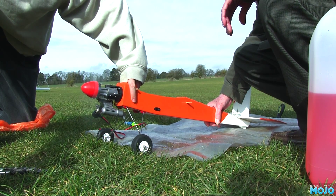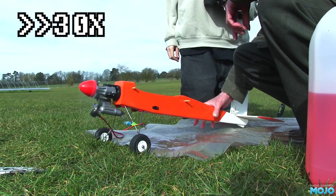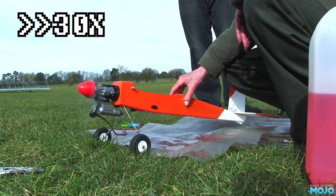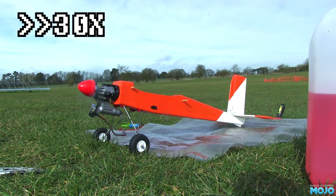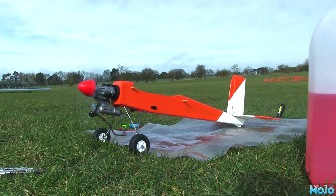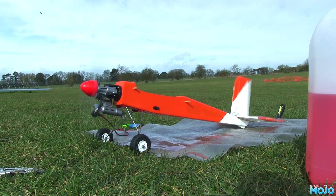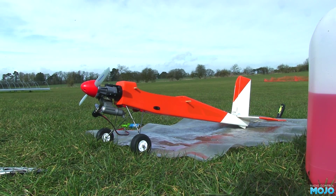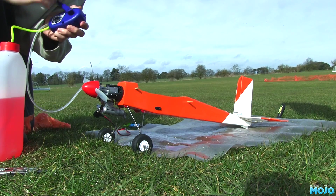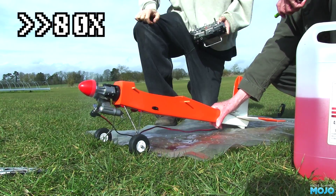Just listen to that engine struggle to burn all the fuel we're giving it. The needle ended up way out, nearly three and a half turns - this isn't of course the final setting. The balance at this stage is between keeping the engine nice and warm and having loads of fuel and therefore oil running through the engine. It ran like this for about eight minutes before it ran out of fuel. You can hear it lean out just before. First tank through - now it needs to be left for a couple of minutes to cool off. We can pump in some more fuel, start it up and go again. This time I'll lean the mix just a little bit as it's going through fuel like it's water.